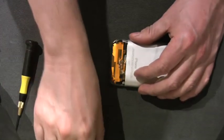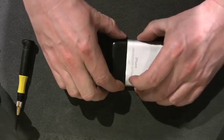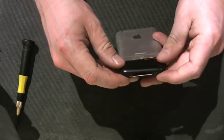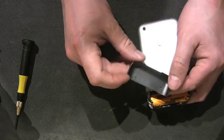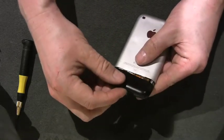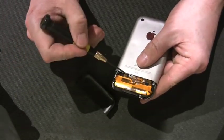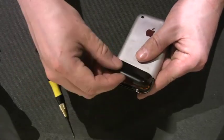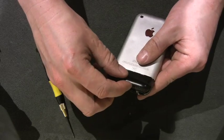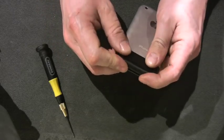And here they go, just going back in. It doesn't take too long. And of course, you put the antenna cover back on. It will snap in there. There are two little tabs on the end that will go into it on the end. Then just at the base of the silver backing, you've got to remember that these have to be depressed a little bit because there's a little rim on your black antenna case that fits down over top of them and then slides in underneath the backing of your case.